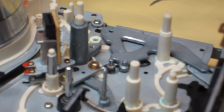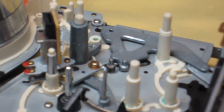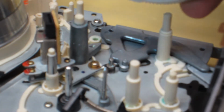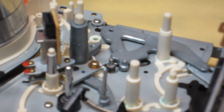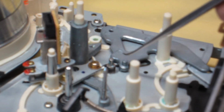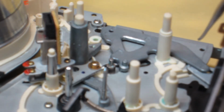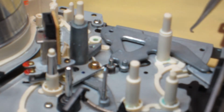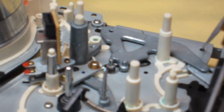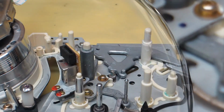Okay, so all of this has to be aligned on the top side, because remember, on the bottom of this cam gear, we have those grooves, those channels, and these pins, once again, have to be sitting in their appropriate channel. And we'll go ahead and confirm that via the same type of mechanical alignment points, making sure that everything is in phase. So, anyways, let's go ahead and get to that.